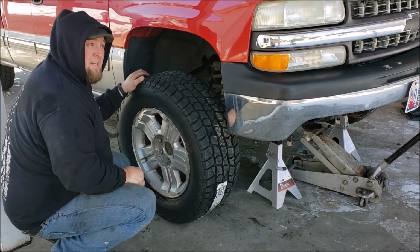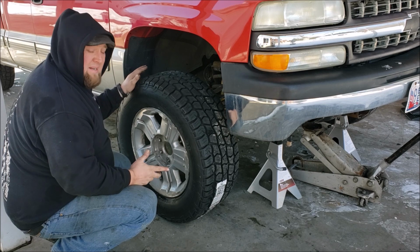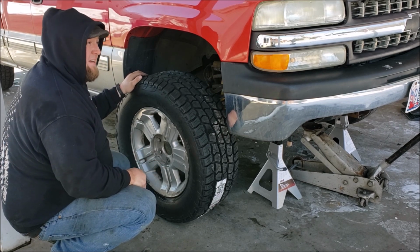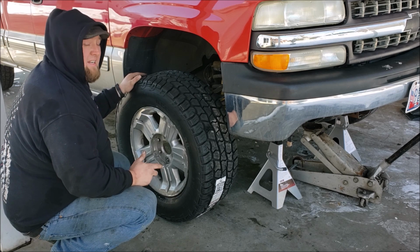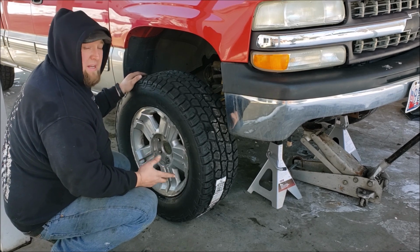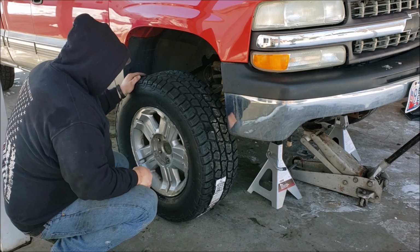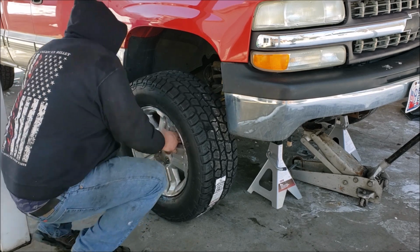I don't balance the slicks on the race car, so I know some people say you should, but I've seen them enough times where the weights get pitched off either in the burnout or on the big end, so I just don't do it.